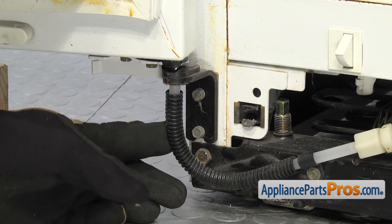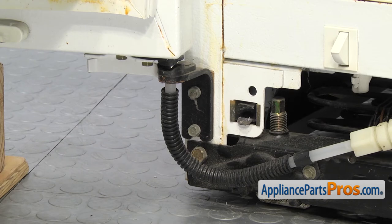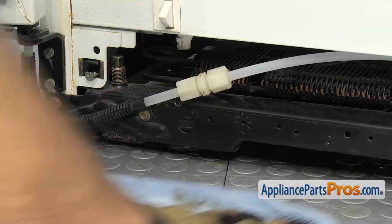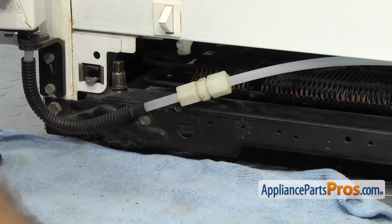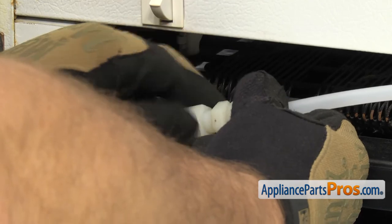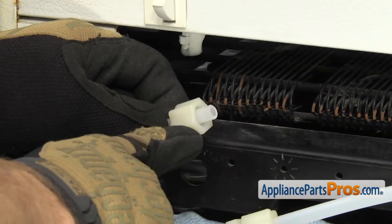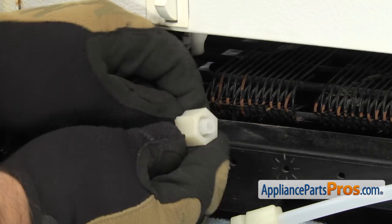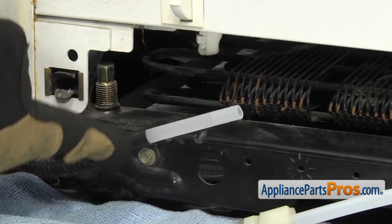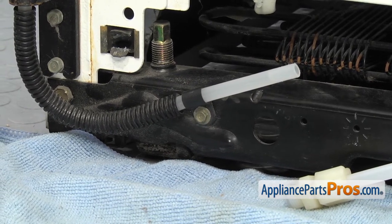The only difference is on the freezer door, we have to disconnect the water line so we can pull the hinge off of it. We're going to show you on the freezer side — if you're doing the fresh food side, just skip the step with the water line. We're going to put a towel down to catch any water that might come out when we disconnect the water union. All you have to do is grab it and disconnect one side towards the hinge. Once you have the union disconnected, we can pull the nut off the water line, carefully pull it off and set it aside. Then we're going to use the quarter-inch socket to take off the little clamp that holds the water line onto the frame.